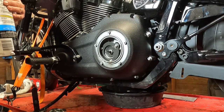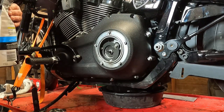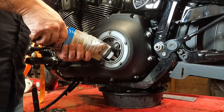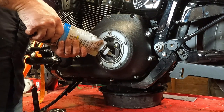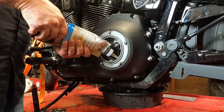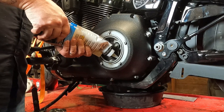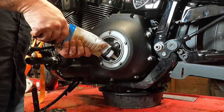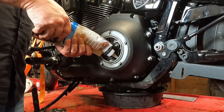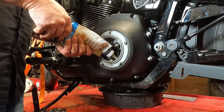Now, you can take your 1-quart of gear oil, it's technically a wee little bit under, I think it's like 0.9 something quarts, whatever, just put a quart in it. Fill that up. You can't overfill this. As you can see, I'm just squirting the oil down in there. Just fill it all, put the whole quart in there, and the theory is it should fill up to basically the bottom of the fill hole. Just a little bit below that, so you can't overfill it. If you do, it just spills out.